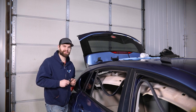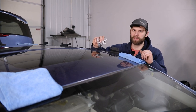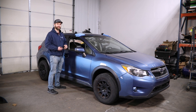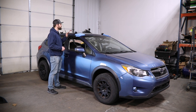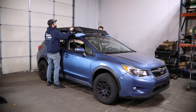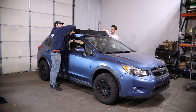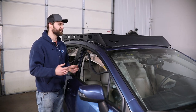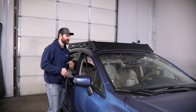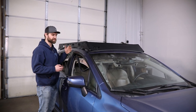Now with all that hardware started, we can do the same thing on the other side. You might notice once you get around to installing your last bracket that you have a little bit of hardware left over — that's not a big deal, this bolt pack is shared between a couple of different products, so you can just discard that. We took some rags and set them out on each corner about where the rack would land just to protect any painted surface. Now grab the help of a friend to help you set it up on the roof — your side rails on your rack are going to bolt to the outside of each of these brackets. Now that we have the rack placed up here on the roof, go ahead and start installing each of your quarter-inch bolts from front to rear — get each one started loosely before you tighten anything up. With all this hardware loosely installed, go back and fully tighten all your mounting bolts through the roof. Now that all your mounts are tightened down, you can go ahead and set your rack height using these side mount bolts — pull up or down in those slots, make sure it's running parallel to this roof line, and then go ahead and snug it down.